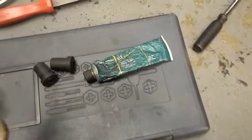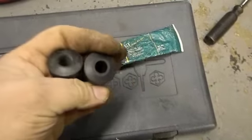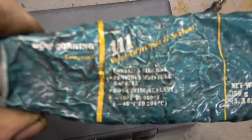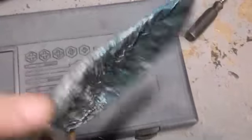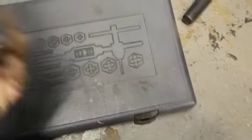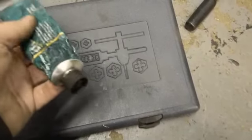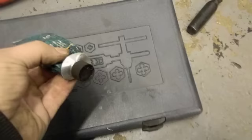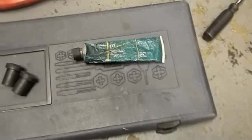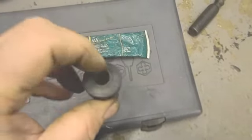On the bottom it's just got this long nut-looking thing with the same deal — I just went with three 5/16ths nuts. The leaf springs came with new bushings in the front which are pressed in, and the rear bushings you just slide them in — they're made out of some kind of rubber. This is what I use: it's made by Dow Corning, it's 111 — it contains silicone. This is what you'd use on leaf spring bushings, especially urethane bushings. It looks like Vaseline but a thousand times thicker, stays there, and lubricates. That's what I'm going to use inside these bushings before I put it in.